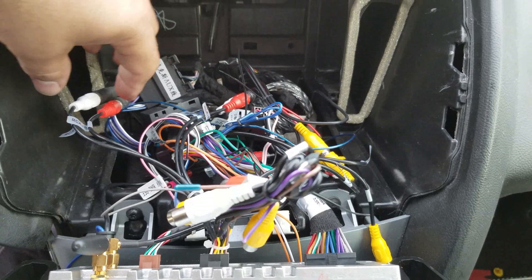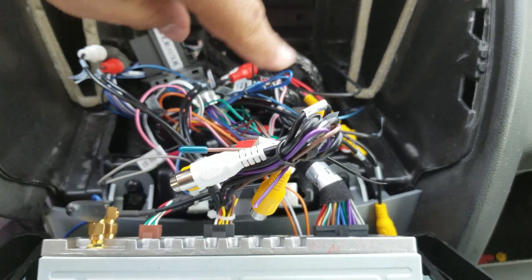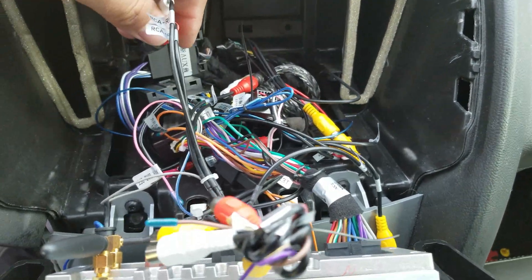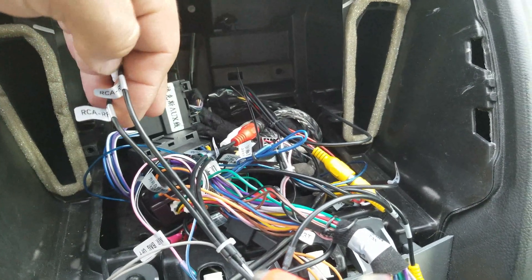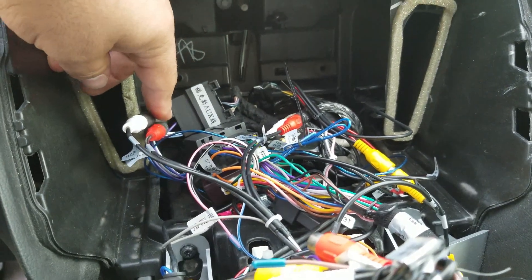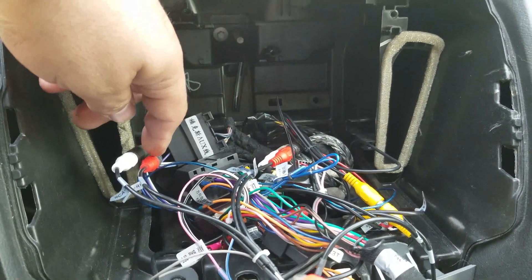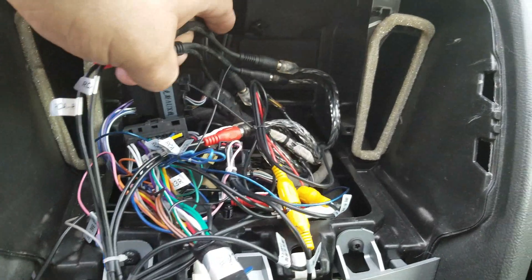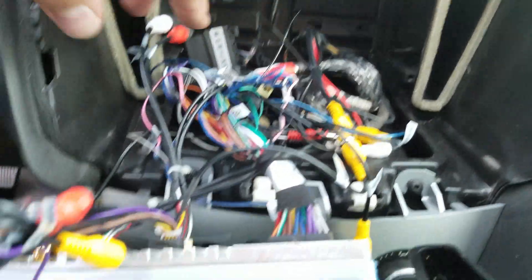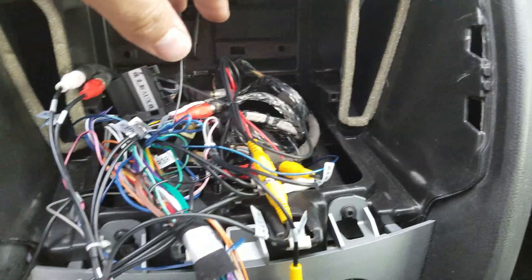I've been hard at work getting the radio portion figured out — it's not the easiest. I really couldn't find a place that had sub out specifically, so what I did was I used the speaker wires, since I'm going to be using a powered sub for the speakers anyway. I teed into those, so my amp on the subwoofer side tees out of one of these RCAs — that comes down into the splitter right here and then tees out to the back. It's all quite a mess; I've tried cleaning up some stuff with zip ties, but it still just looks terrible.